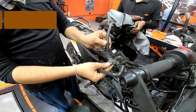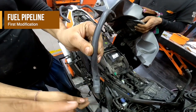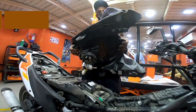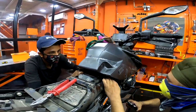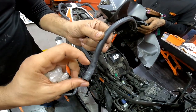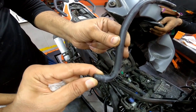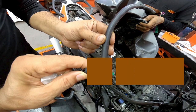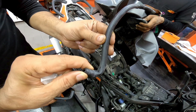The first mod is related to a fuel pipeline, which is carrying fuel from the fuel filter to the fuel injector. This rubber pipeline is located below the fuel tank. As per the service team, the presently used pipe is soft, smaller, and noticed with a kink or twist which might obstruct the fuel flow. Even my motorcycle is noticed with similar permanent deformation or twist at 1500 km.